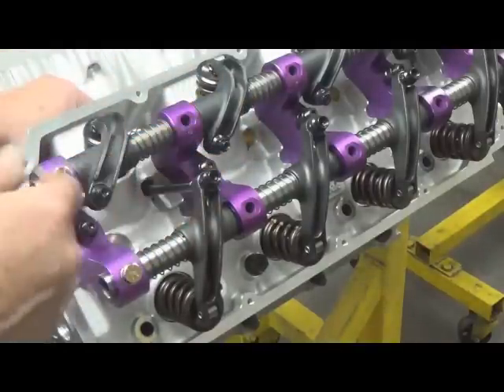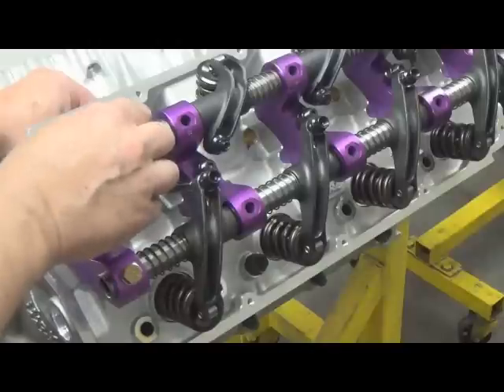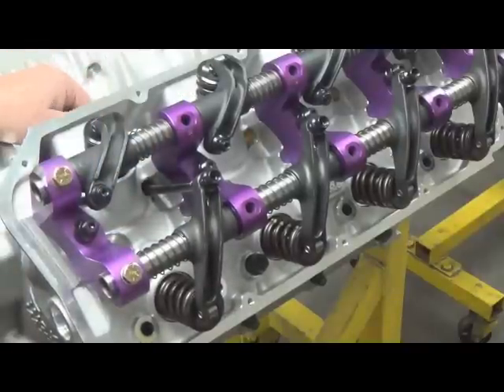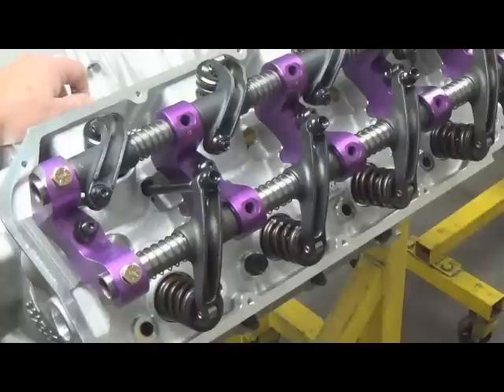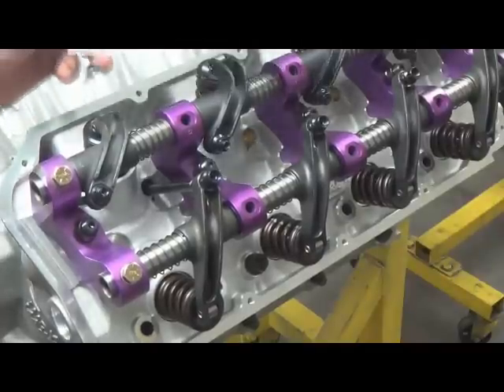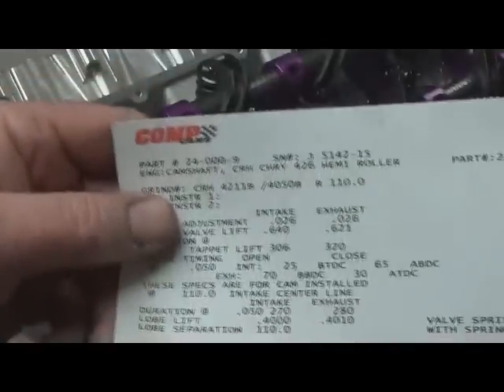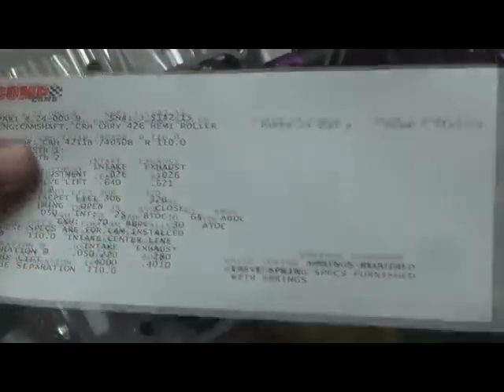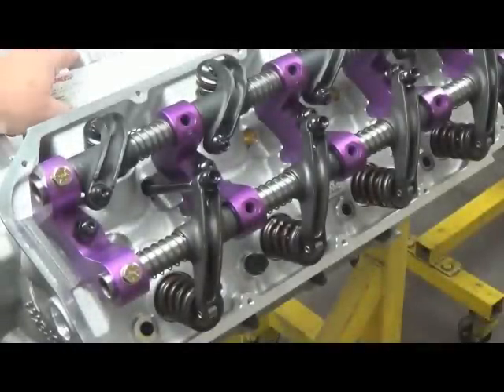It'll keep you out of trouble and it's really easy to remember. That's how you adjust it — it'll work on a solid, hydraulic, whatever it might be, even a one-lunger Briggs. The next thing is valve lash settings. If you get a cam card, it'll tell you the valve lashes. This one happens to be 26/26.